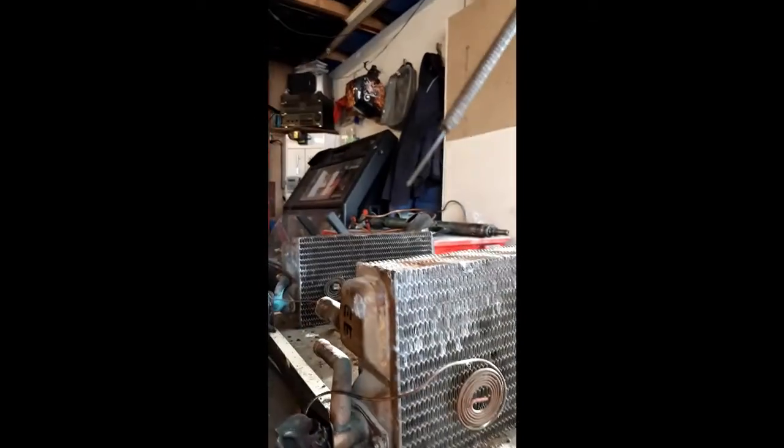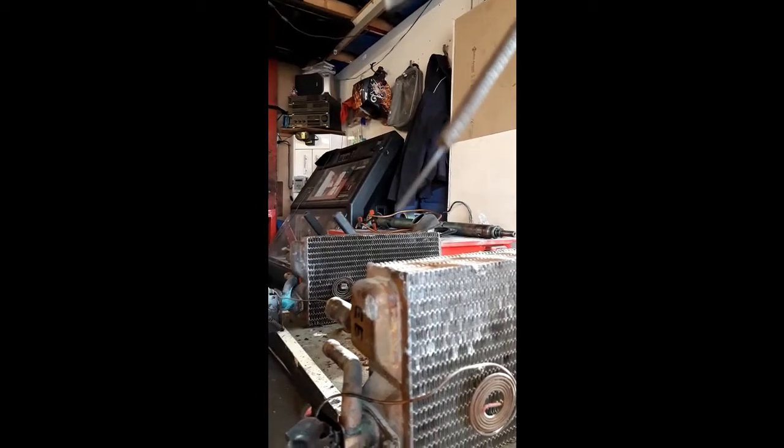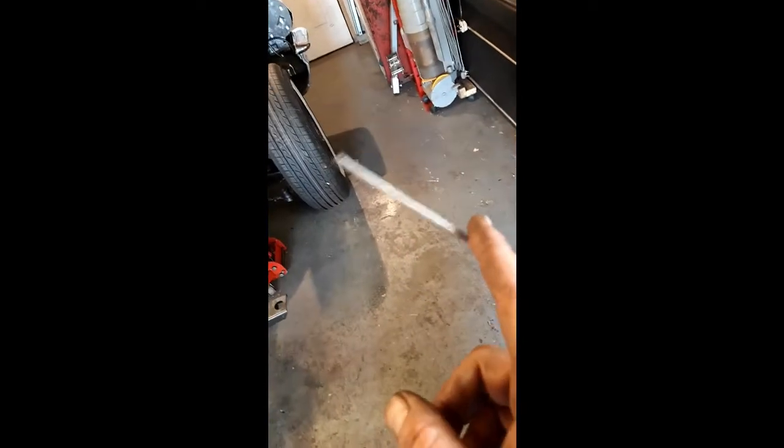Now, obviously with it being seized and somebody trying to move this, it's snapped the end off. So basically I need another one of these. Now again, I probably had one on the 62 caddy, but when I took the heater matrix out, I chucked everything else away. Sod's law. However, I have got this Bowden cable here, which is the old one, which I just cut. Luckily cut it there, so now I've got a nice long Bowden cable here. So I'll just take this one off.